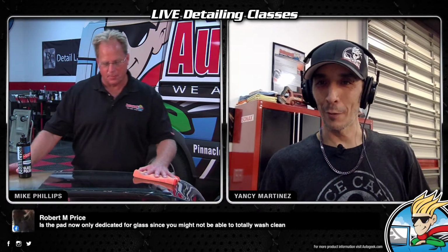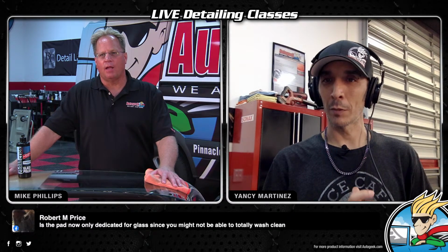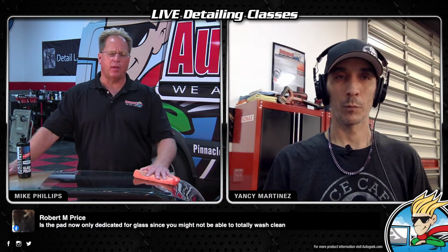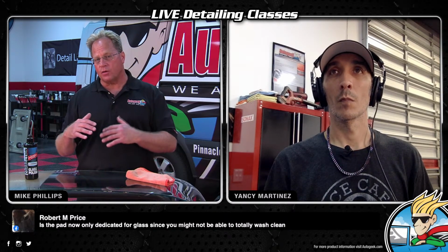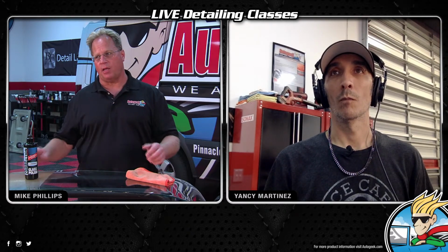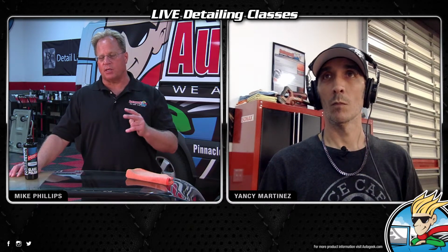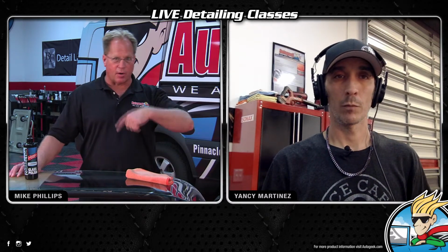All right, let's go here, Robert. Is the pad only dedicated for glass, since you might not be able to totally wash it clean? No, but that does bring up a good point. A lot of times when I'm doing any kind of polishing with something that uses abrasive technology that's not safe for paint, I mark the back of my pad, wash it by itself or with other glass polishing pads, and dedicate it for that. Don't cross-contaminate. Nobody likes to buff out a car twice because the thing you were using micro-marred the paint.